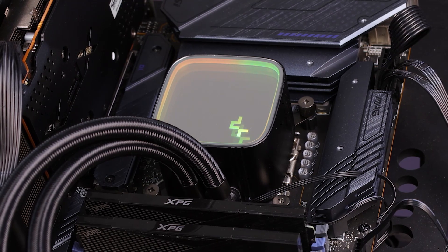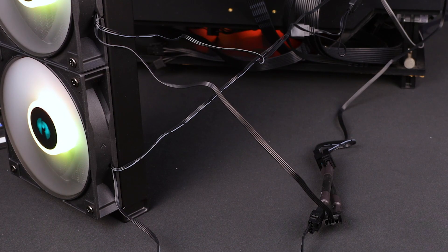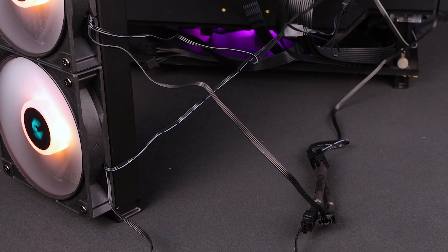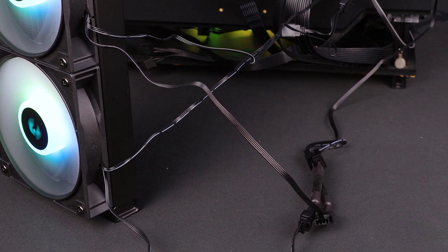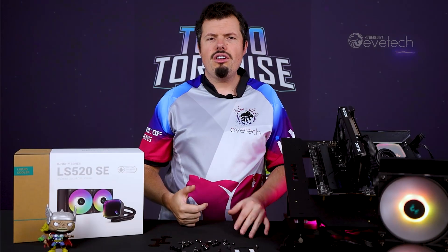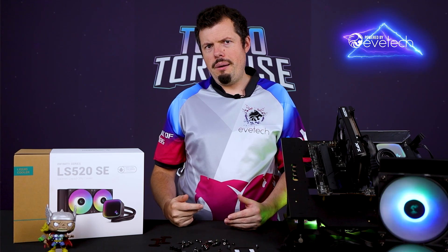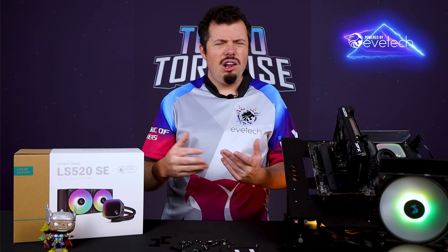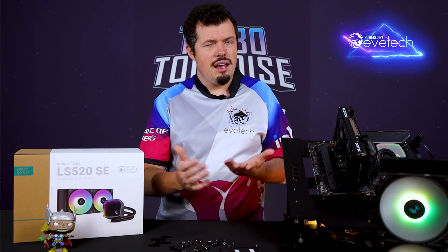You could feasibly connect both fans directly into the motherboard, except they come with rather short cables, so it's implied you'll need to use the splitter in any case. The package includes two other fan cables which might look a little odd — they have a four-pin male and female on either end — because there are resistors in those lines. What you can do with them is lock and limit the total fan speed so it actually can't exceed that RPM. If you want to enforce a lower RPM, you can do that.